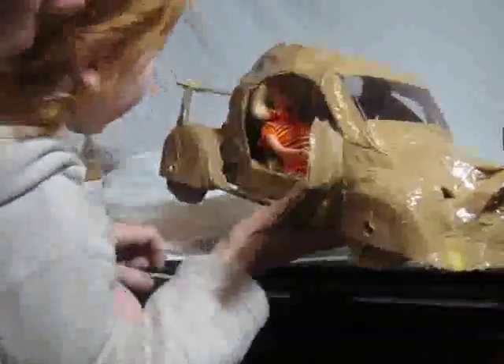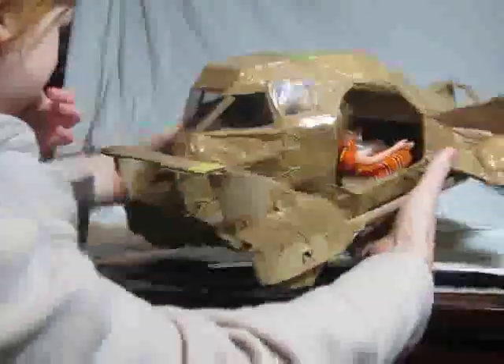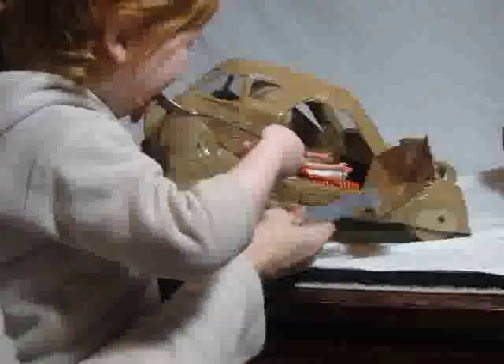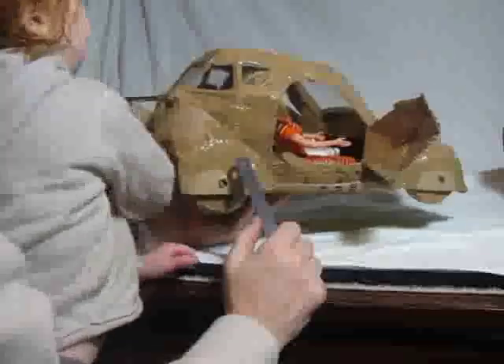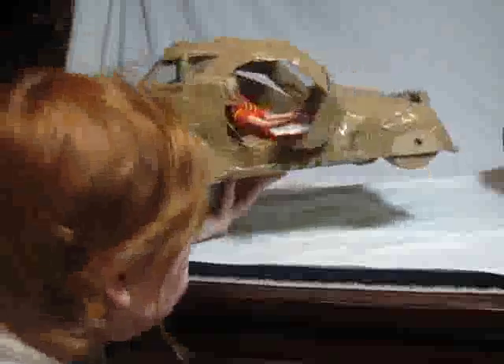In the interior you can actually get three passengers in — one is at the back as well. The width of the vehicle is one metre on top. We deliberately put scoops in the doors so that the shoulders would psychologically fit — you'd be able to put your elbow on there — but also you can get a side impact protection bar in to fit against the roll cage and the space frame inside.